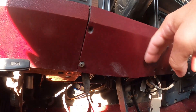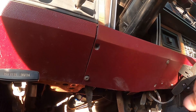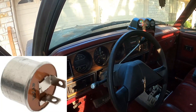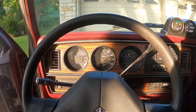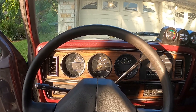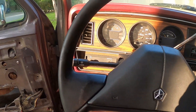Once we verify the bulbs are okay, you'll want to go inside and check the fuse panel, which is right underneath in these trucks. Pull it out and there's going to be a round flasher in there - make sure that round flasher is good. On this one it did blink slow when I first got it, so I went ahead and replaced that flasher and it flashed at a normal rate.